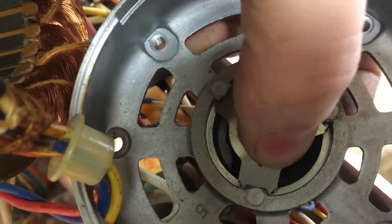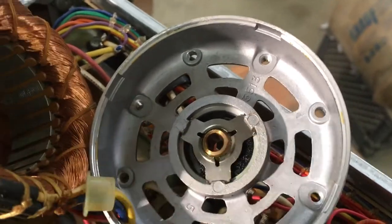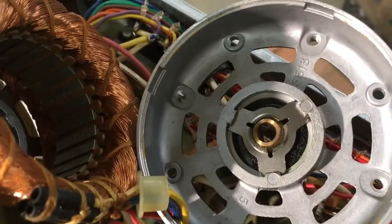The motor end plate actually has not only a bronze bushing, but one that articulates around to compensate for any crookedness. And there is a piece of foam in here that is soaked with oil. So I'm going to try to get this out — it'll probably fall apart on me. I'll replace it with another piece of foam and re-oil it. Do the same on the back end, do the same on this motor.